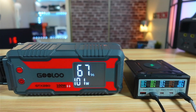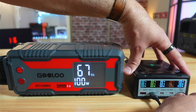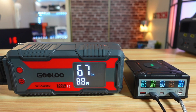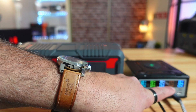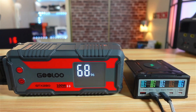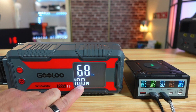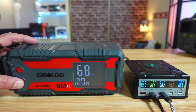So the first port is accurate. Now I'm going to change the cable to the next port. This port should also provide 100 watts. What's happening here is it is actually drawing 99 watts, which is very good, but the display on the charger is showing only 94 watts — so that reading is not very accurate. For the second USB-C port, the charger display shows 100 watts while the measured draw is 98 watts, which is within the margin of error.